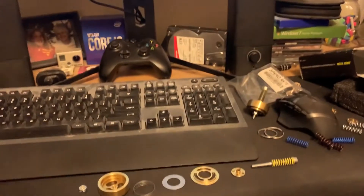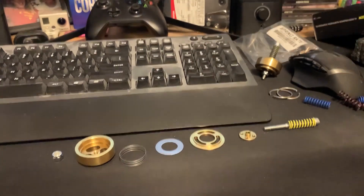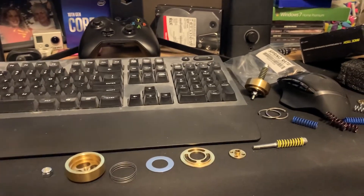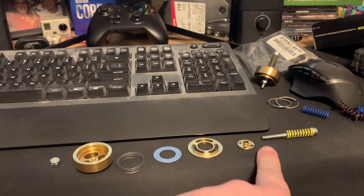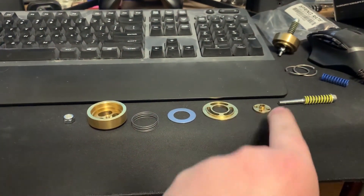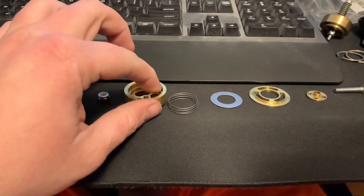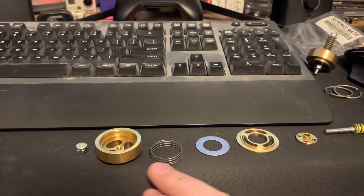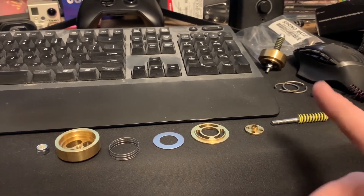The reason I wanted to make this video is to touch on the main part of the gold valves that BikerBits did not cover for the DR650. If you're going to do this, you absolutely need to drill out the holes on your damping rod. Otherwise, you're basically just restricting flow to this device. I believe the holes should be drilled to 5/16 inch.